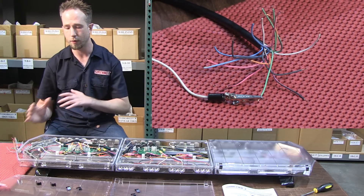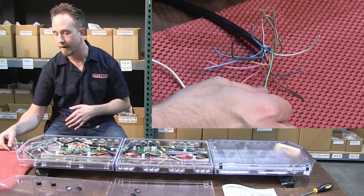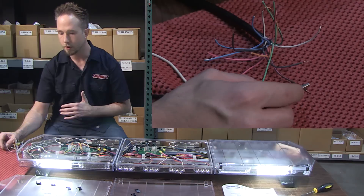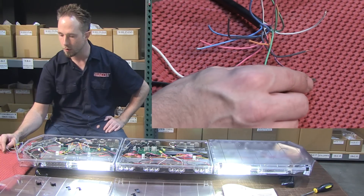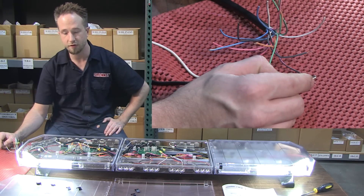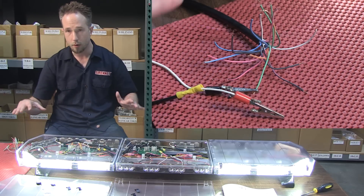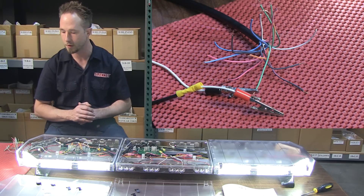Not everybody is going to take advantage of that with a cutout — most folks do that with your vehicle's slide switch, kicking down from position three, two to one to adjust the bar. With that green with white put to a positive 12 volts, and by making another positive 12-volt adjustment to the black with red trigger — that's the light bar's programmer — we can go ahead and latch it in. The front set modules are now steady burning in white. By continuing that process, we can switch over to a different set of modules, doubling up the illumination and the inboards, then further outboards, rounding out the 45-degree corners. For those wanting the full scene light, rounding all the way out to maximize your vehicle's driver and passenger side forefronts — all the multicolors steady burning in perfect white for illumination.